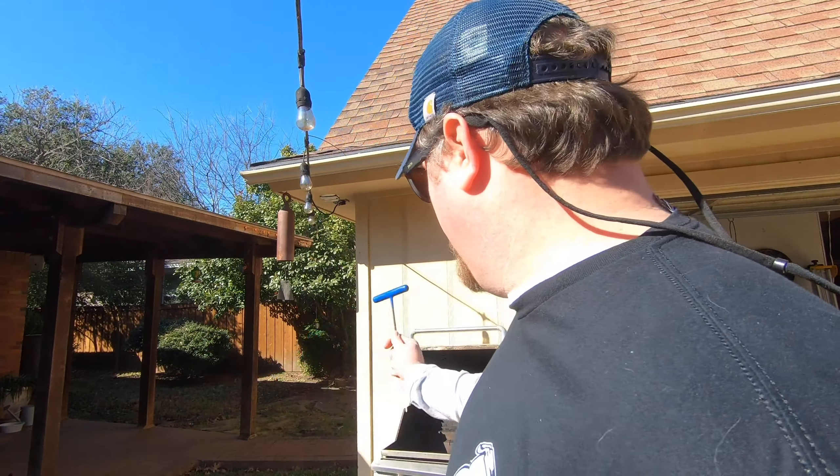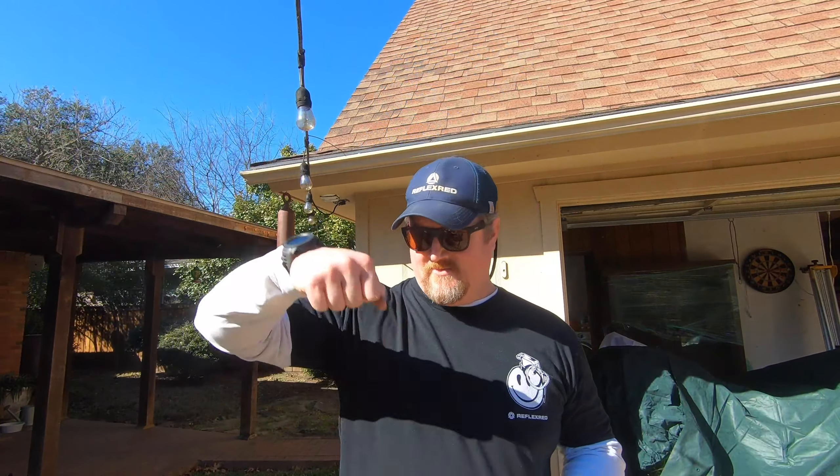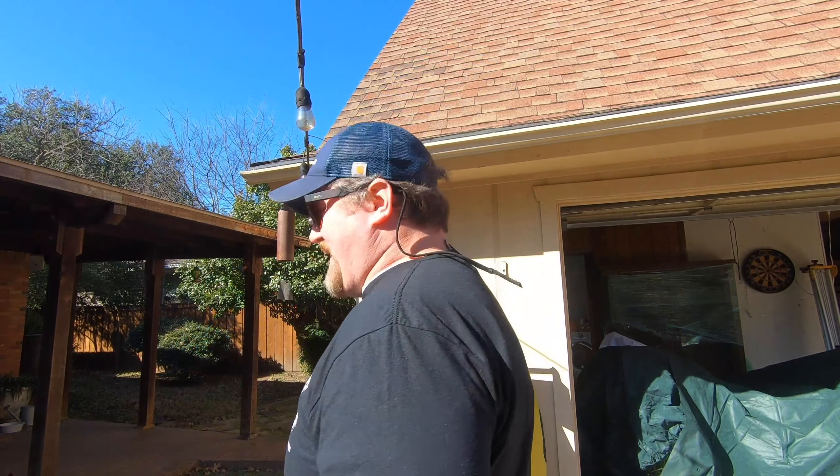Again, don't forget to bag and label your nuts and bolts. Next up, we're taking the whole lid off — the lid that comes down that keeps all the heat in. It looks like it's just held on by two bolts on either side, screwed in with an Allen wrench. I went ahead and found a 3/16ths Allen wrench that looks to be the right size. It doesn't look like there's any nuts on the back side, they're just screwed in, which seems a little janky to me. Whenever I put it back together, I'll probably take the bolt up to Home Depot and find a nut and a washer that fit on the back side to just keep it secure.